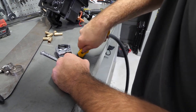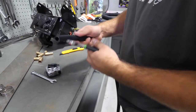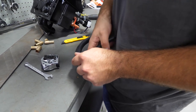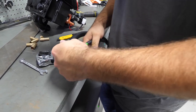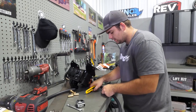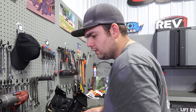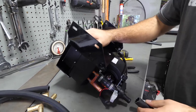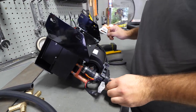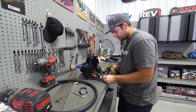Next, we're going to grab our hose and cut a section approximately two and three-eighths inches long — take a pair of side cuts and cut through to get a nice clean edge, then clean it up with a razor knife. Now we have our piece cut, so we're going to go back here to the back side of the heater, slide it right onto this fitting, grab one of our clamps, slide it up, and go ahead and tighten it down.